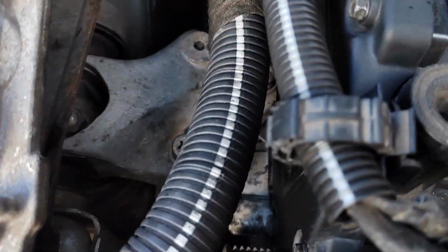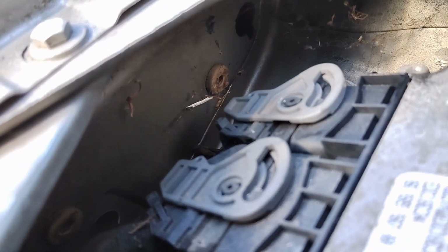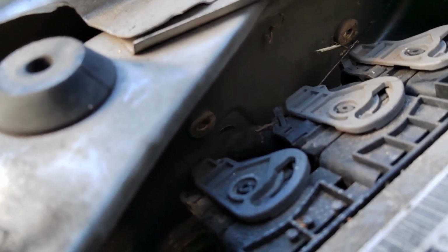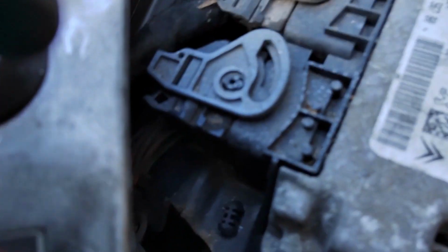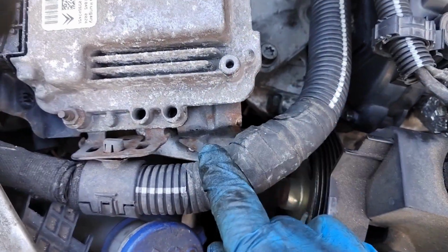But if you remember, the top part of the mount was T50s. Then we've got the nut down there, which is a 16mm nut. We've then got the two 13mm that go on there. And then what you'll look at is down in here, at the end of the screwdriver, there's a little white tab there and a little white tab there as well. It's not going to show up properly, but on the back of the ECU, we've got little spikes, one there and one just there, and they go into those white tabs just there. So that will slot in. And then we've got the 10mm nut down there, which I've snapped, so I'm going to drill out and put a nut and bolt through it.